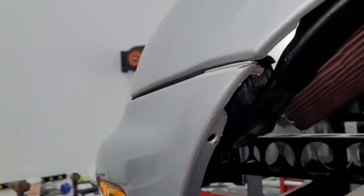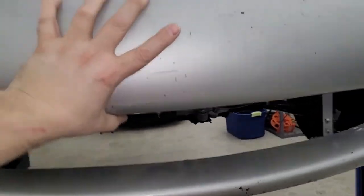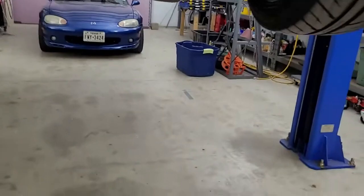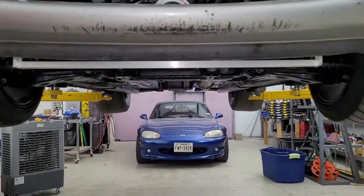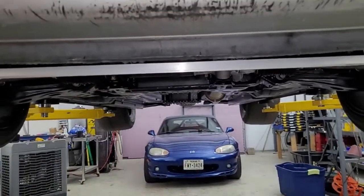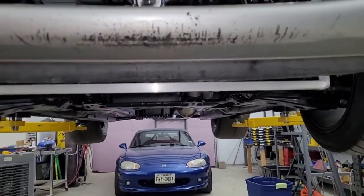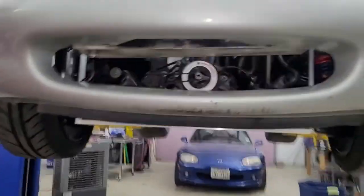The bumper is doing great — we've got six bolts holding it now, plus there are more bolt locations I haven't installed yet, so that'll make eight total. The whole car's not moving around anymore — that's solid. Looking at it head-on, the metal skidplate is actually a little lower than the bumper lip, which wasn't what I was going for. I think what happened is when I originally mounted the bumper without all the bolts in it was sagging, so I set the metal lower — now with the bumper properly bolted up it lifted.